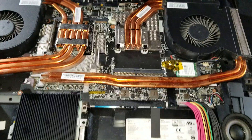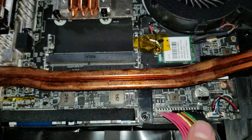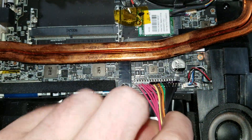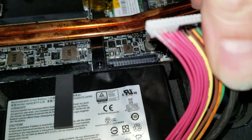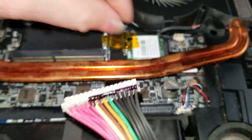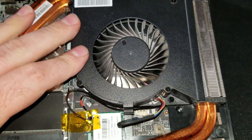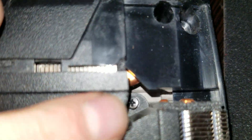Now we're going to start with the CPU first. You can start by unplugging your battery here. So you can start by pulling this up, and that makes sure you don't have any capacitors or anything current left in your laptop. Then you go over here to the right fan when it's upside down. I've already disconnected mine. There's a screw right here, and there's a screw right here.